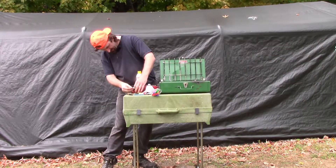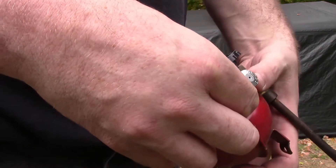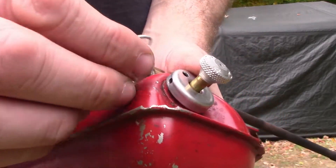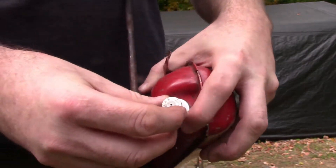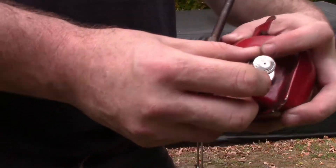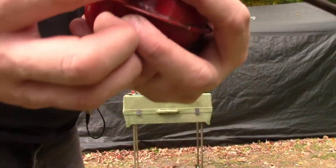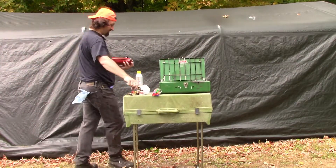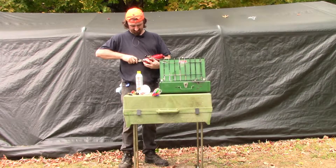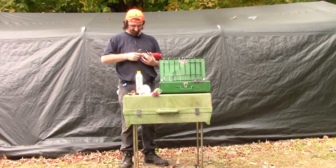That's got a lot of back pressure now. The retaining ring has two small holes in it, so we're going to line up the cap with the holes in the base of the tank. This is the part that gets tricky — at least for me. If you have better hand-eye coordination it might be easier. We're going to have to bend that open to get it all the way across, so keep your finger on this side. We're going to grab a pair of channel lock pliers because they're angled — they allow you to get a little more leverage. We're going to stretch this out and over so it gets into the other hole. And there we go — it's all on.